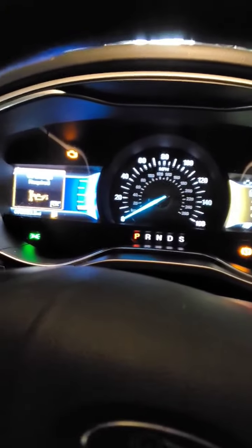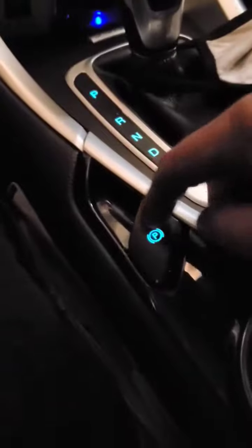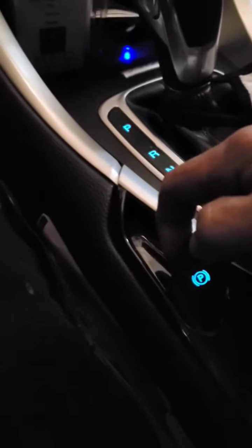Get it started. The key ignition is on. It says parking brake maintenance mode is on. So to turn the maintenance mode off, it's basically the opposite of what it was to turn it on — ignition to the on position, car not running, foot on the accelerator, pull up on the parking brake.